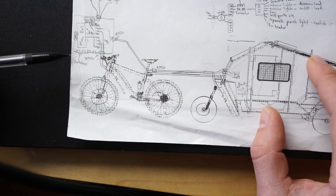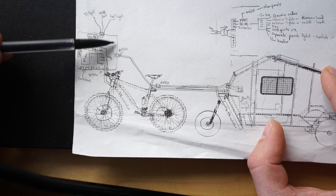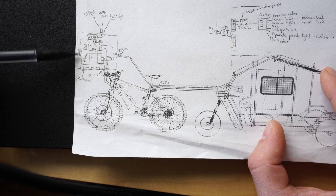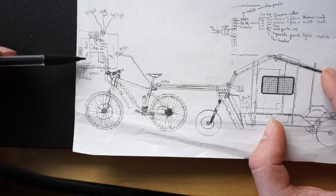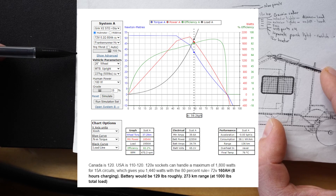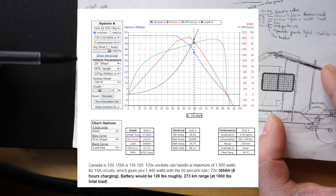Let's move to the main battery. Just picture this as the cargo bay of my bullet bike — this is the front cargo bay where I'm going to have the main battery. I'm still not sure exactly how big it'll be, but I'm thinking close to 150 or even 160 amp-hour at 72 volts — somewhere around 10 kilowatt-hours. Using the Grin Motor Simulator online, which I'll link in the description, that gives me an estimate of around 273 kilometers of range based on these inputs. This is always changing, so I'll provide full real-world test results in the future.